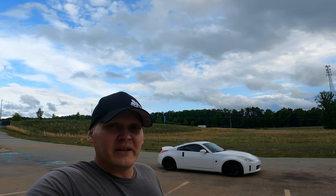I don't think I'll go up in tire size — I've slid on 265s before and it feels like too much grip for this car. I'll probably stay on 255/35s. I think the fitment and everything looks decent — that's probably where I'll stay. I'm excited and ready for another drift event. All I need to do is get a proper alignment instead of just eyeballing the camber plates, and then I'll hit another drift event. The tires don't rub on the inside of the car now with the angle kit, so I've got a bit more angle.